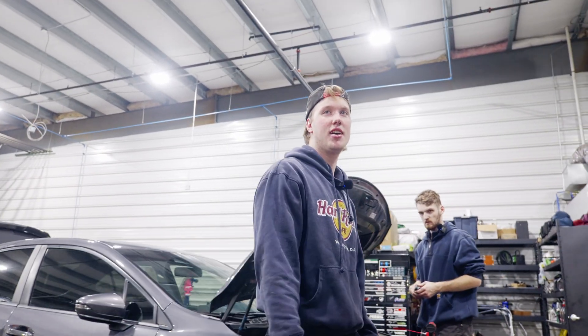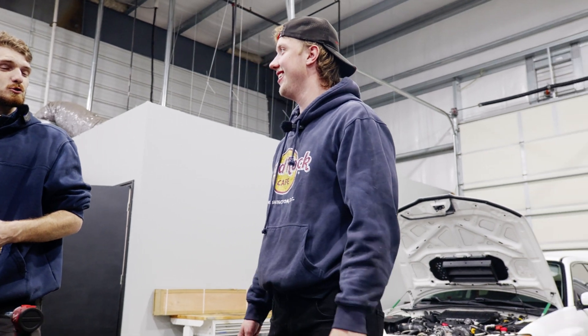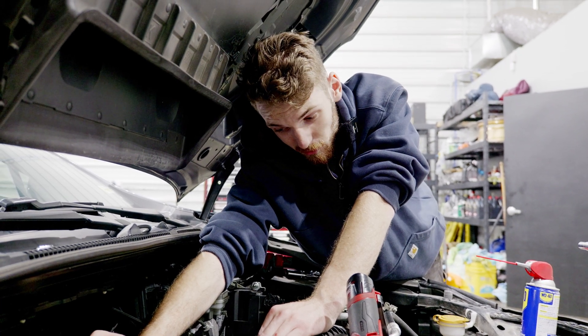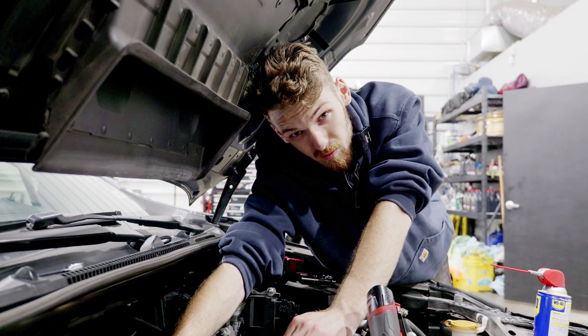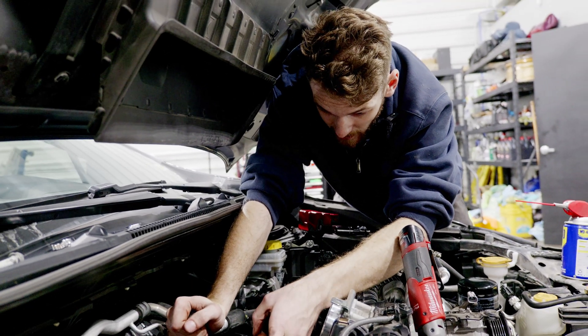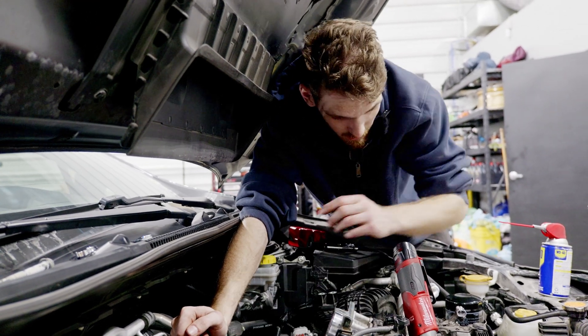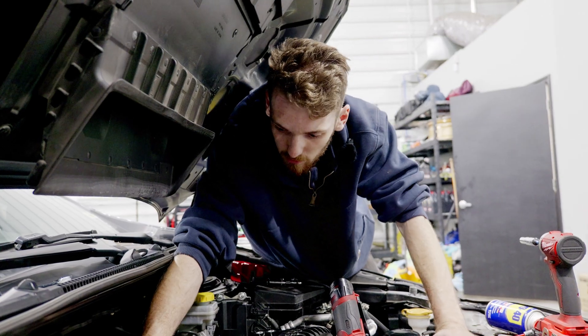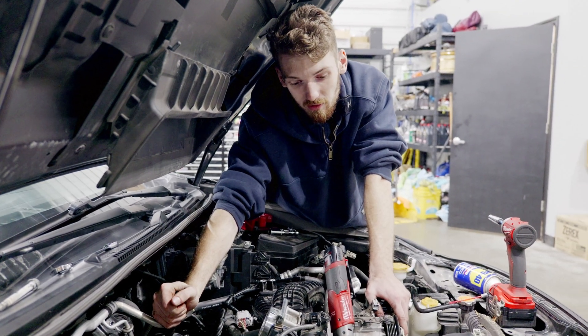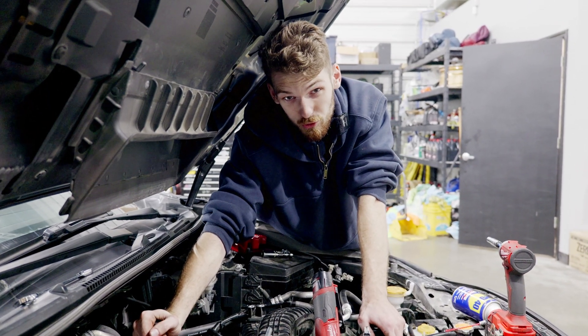I made sure to wear a hat today because last time I was insecure. Get to work, dude. Shut it off. When we were outside the wind goes and my hairline's just like ooh — I'm wearing a hat from now on whenever we film. Two options: you can either break this thing off in the block, but I really don't want to do that because this is a starter bolt and that means the starter only has one bolt. If I break it off in the block, the likelihood of actually removing it properly is a lot lower.